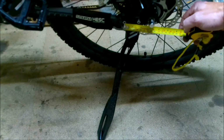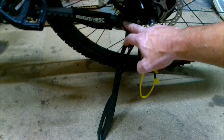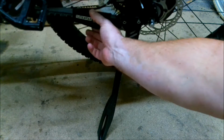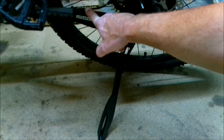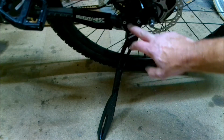The hole centres are 40mm apart, and I'm sure these are M6 bolts. So all you need is a stand that has its hole centres 40mm apart with M6 bolts. That's all you need, and it can be found. I'm not going to go into it, because all I did was go on eBay and look through loads of stands, and obviously because this is a bit more sturdy, it'd be a swing arm on a motorbike, but it doesn't swing on this. Your swingless arm is obviously thicker. So the ones that clamp on generally don't fit these. So you need the bolt-on ones.